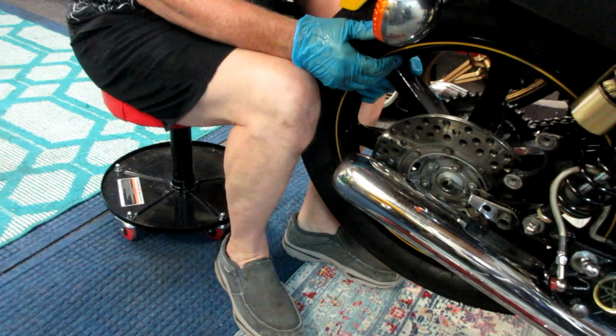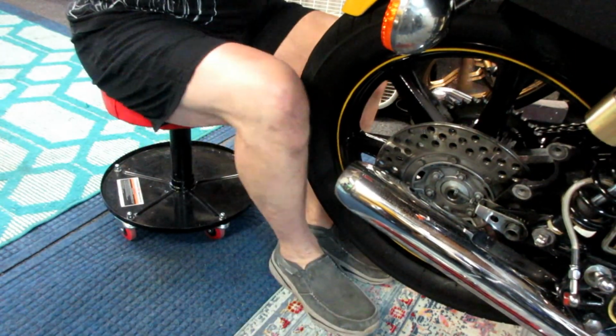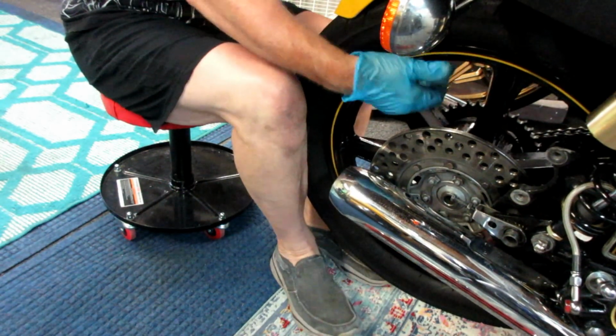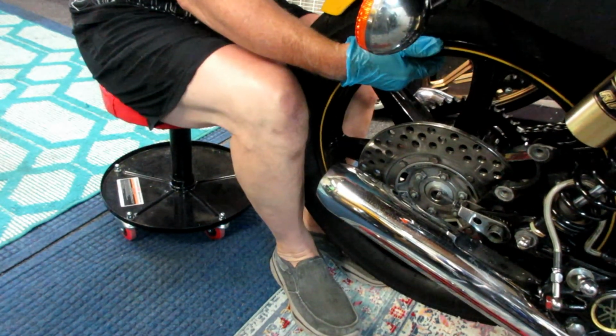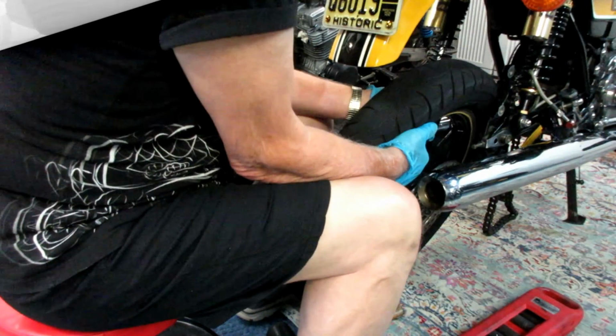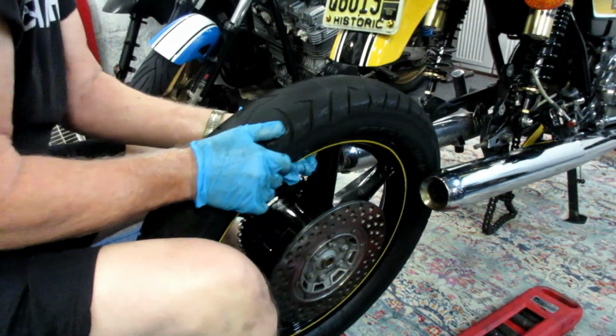Now, this gets to be a little tricky as you start trying to take this wheel out, and there's a bolt on the bottom of the caliper that holds the caliper from rotating that gets in the way. You can take that out right away. That makes it easier. There's an awful lot of little things, and you've got to wiggle and woggle and do gyrations.